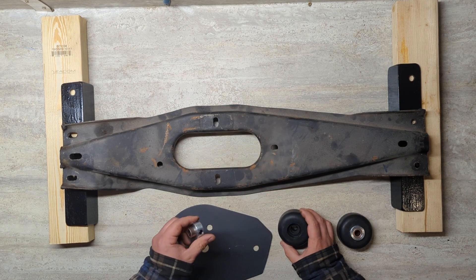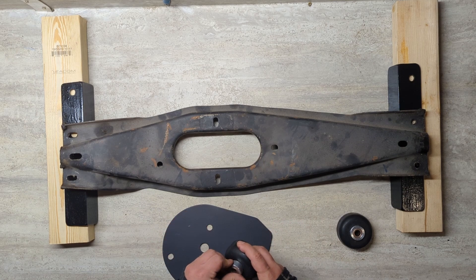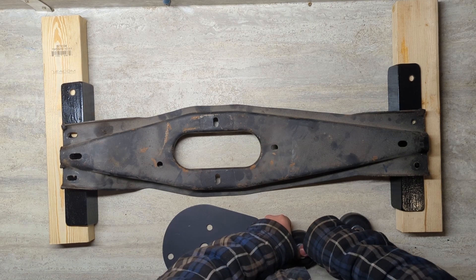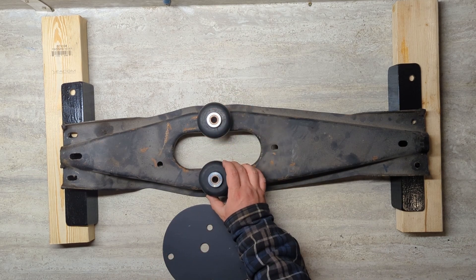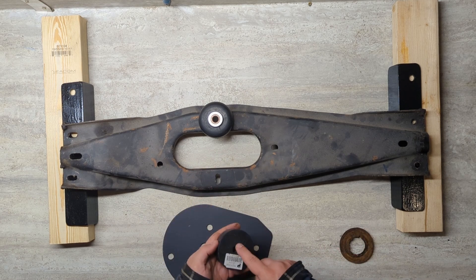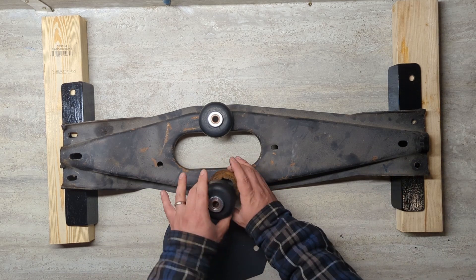This is just another one of these shaft retainers, and then a bronze bushing. I just had to drill it out to the size of the bronze bushing — pretty tight, fits good, just squish her in there. There are your transmission mounts. I still have to find something — it's the only piece I'm missing — a ring like this cab mount here. It just sits on the bottom. What I learned with the mock-up was that I didn't like the pressure; it caused the mounts to crack around this rounded lip because it crushed. So this should give it the support it needs.